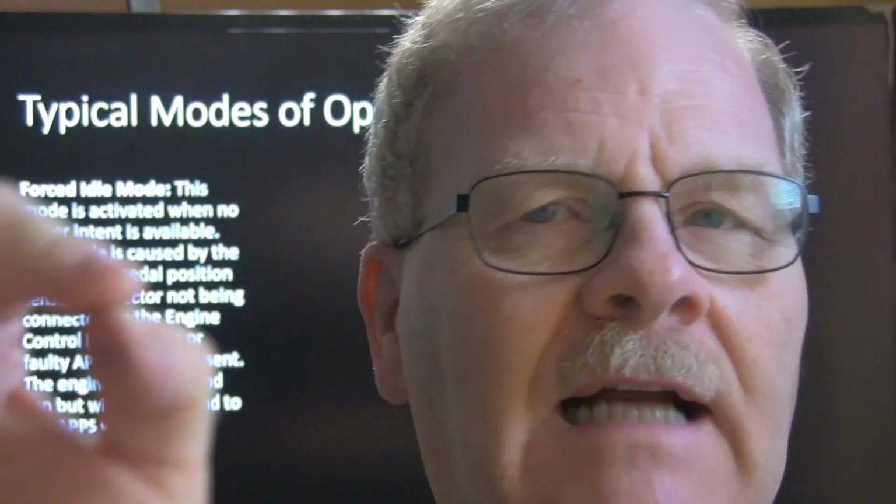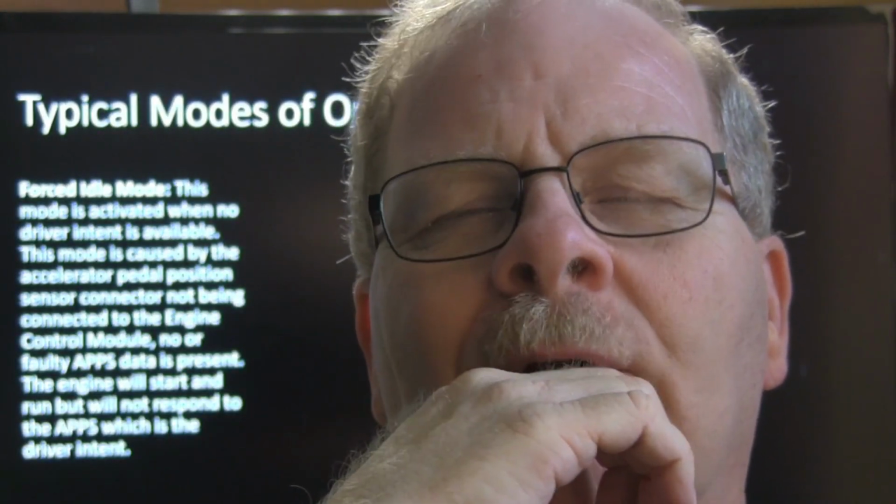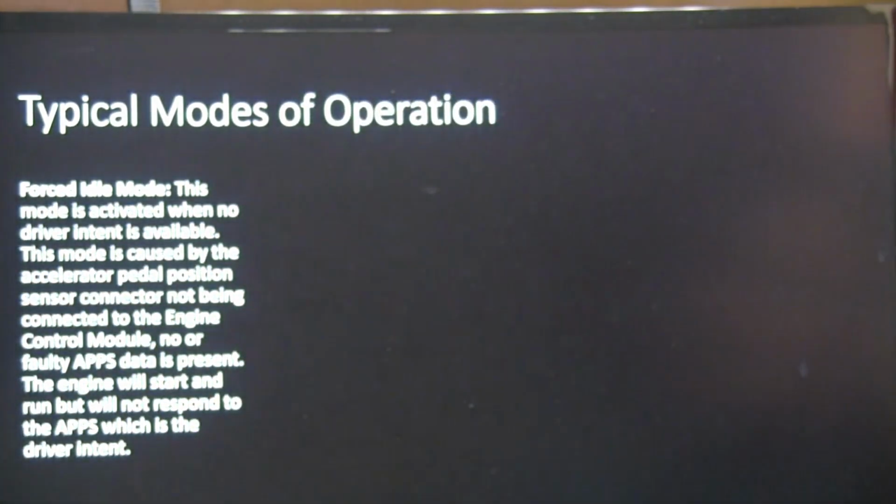But anyway, when I connected that thing to the crank sensor on a Jeep Cherokee without a resistor in series with the scope, it would short that signal low enough that the vehicle wouldn't start, even though you showed a signal on your scope. I always hate that kind of thing.